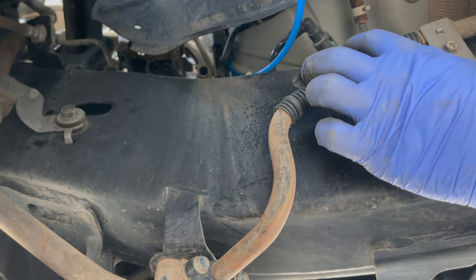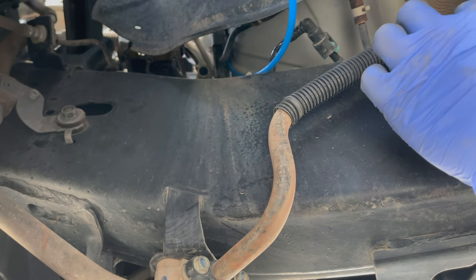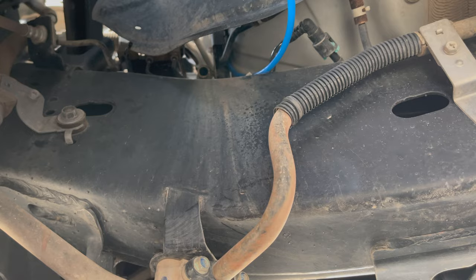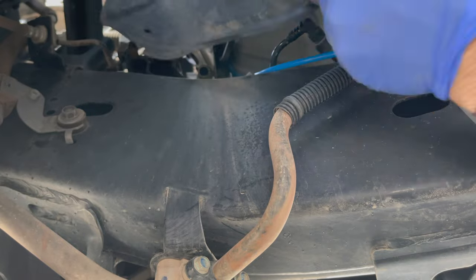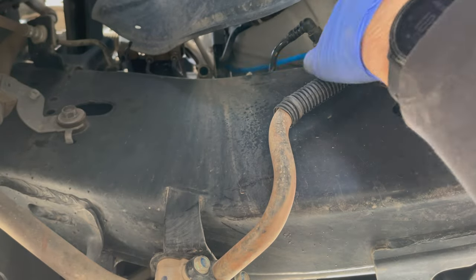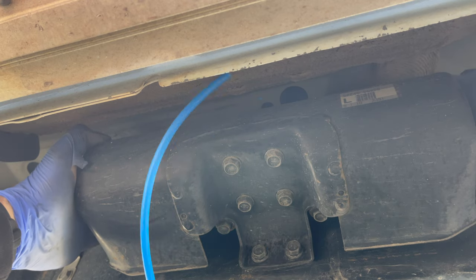From what I can see it runs all the way down the side of this chassis rail, all the way to the back. What I'm going to do is utilize that — run this tube and cable tie it at multiple points all the way along. That's going to keep it up out of the way and it can't get pinched or rubbed through or anything like that. It's a bit hard to show you up in here, but continuing just to run it along the existing pipe all the way down, cable tying as we go.